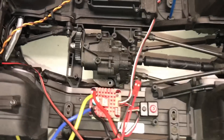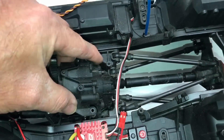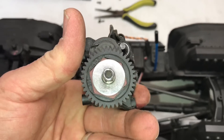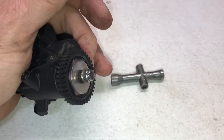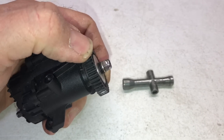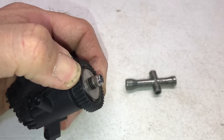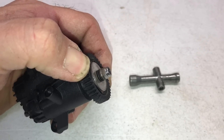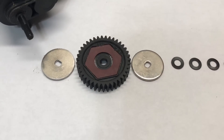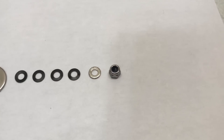With all the bolts out and the front driveshaft loose, I did kind of have to pry it just a little bit. The rear driveshaft doesn't have enough slip to come out, but with all the bolts out, there's your transmission — nice and dirty. To get the spur gear off you'll need a four-way wrench or a seven millimeter socket. When you break the nut loose the spur gear gets loose and the shaft will spin, so put a little side pressure on it to get the nut all the way off. The assembly as it comes off includes a disc, the clutch pad and spur gear, another disc, wave spring washers, a washer, and your nylock nut.